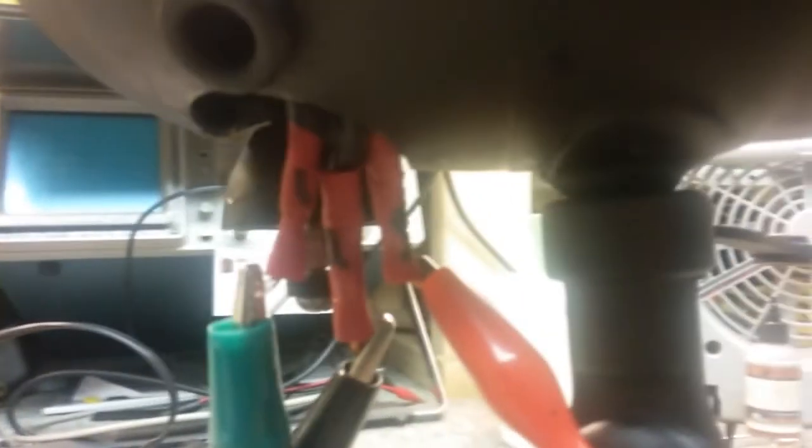The fan is fixed. The problem now is the switch — I've got to connect the head wires. Also, the pieces of wire that were left were missing insulation all over the place, so there was a danger of them shorting together or against the metal case, which would be a real bad thing. I just put some black electrical tape on there loosely while I was testing. I'll connect the head wires and use shrink wrap to make sure they're insulated well, and run them back through the hole.